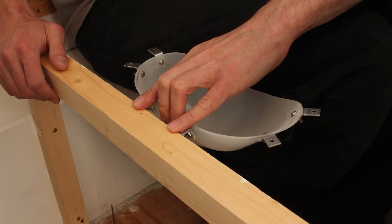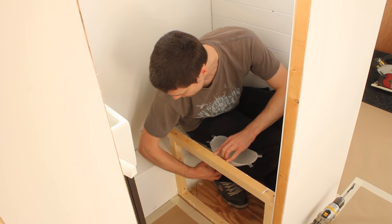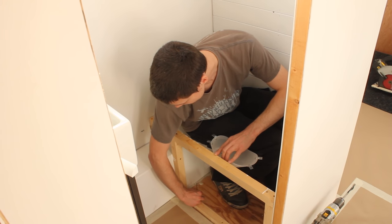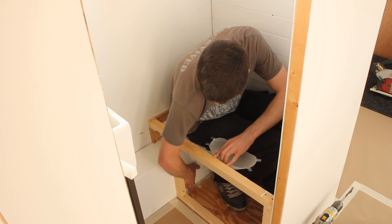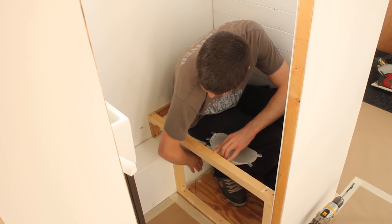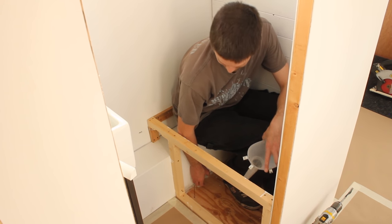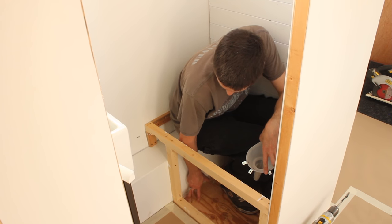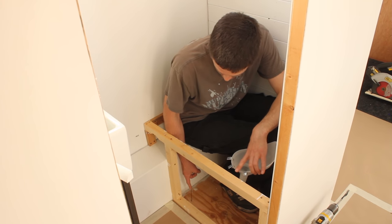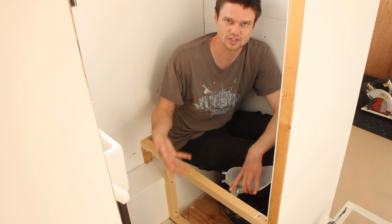And so now all we need to do is figure out where the tubing is gonna go. So it's gonna connect to the bottom of the funnel spout down here, and this is basically a good spot. There's a joist right under here, right up against the fender boxing, and then the axle is under here, right there. So it worked out well. There's just enough space, and I've used a coat hanger to poke a hole straight through, and it's poking down, and I'll show you where it's come out underneath.